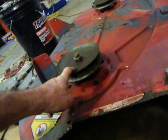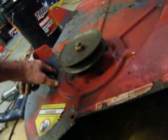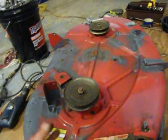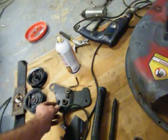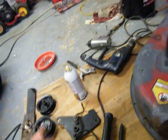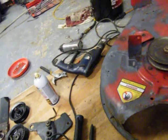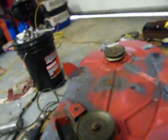Number one, I can't get the spindles off because I've got the blades off right now, but when I flip it over I'll do that. I've already started wiring all this out through here, getting it all wired down, completely clean, getting the oil off. You've seen that big oily spot — that's because that bolt was froze. I've got to get another shoulder bolt for right here that holds the spring tensioner for the tensioner pulley. That's the whole gear setup that bolts into the center of the deck, and then your pulley bolts right here, and then that goes down the middle over there in that hole. So I've got to get another shoulder bolt.